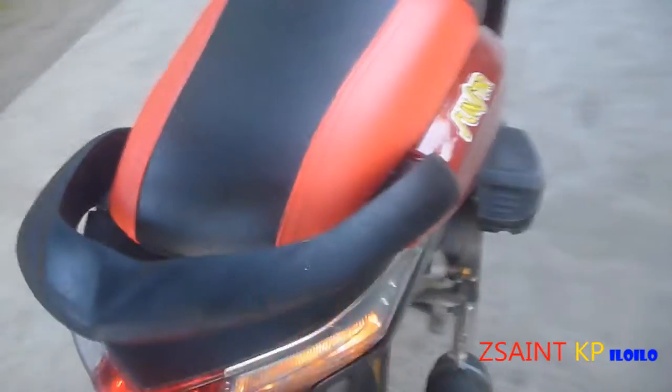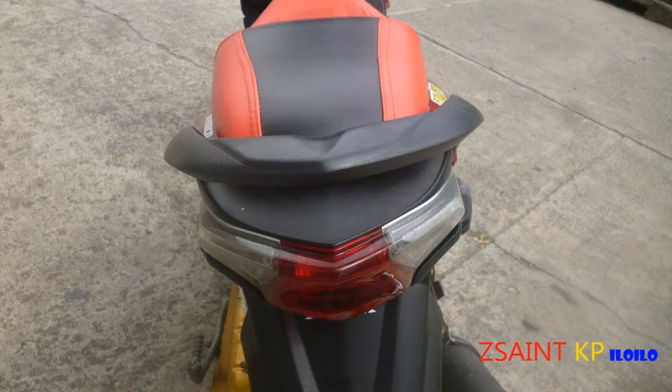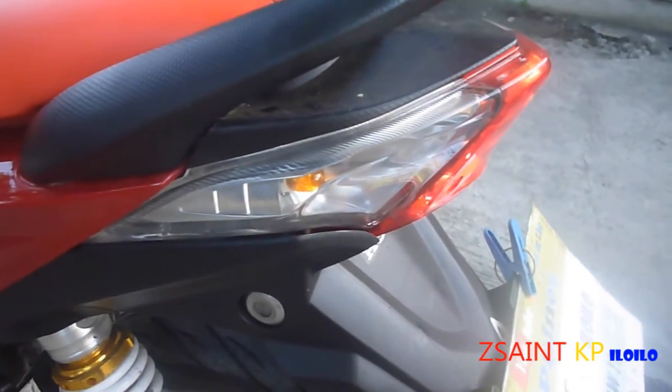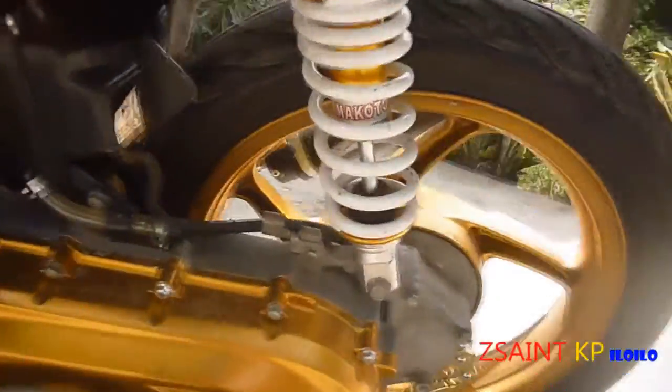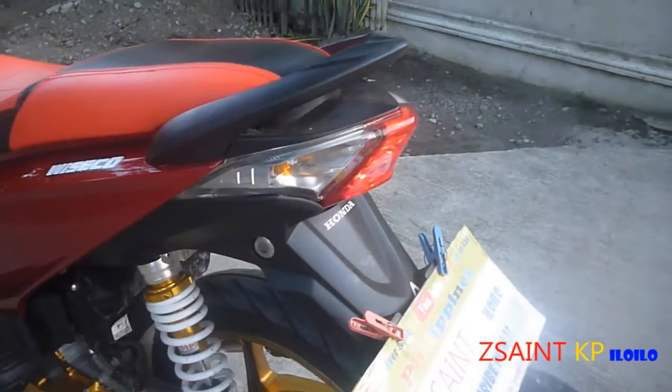All the features of the scooter include halogen projector headlights, urethane handle for the rear, aftermarket exhaust pipes, key shutter, projector taillights, automatic choke system, side stand switch, 1PC engine cover, and dual seat design. Going to the rear wheel, the rim is the same as the front wheel, but it is wrapped with 80/90-14 MC 40P. Brakes for the rear consist of mechanical leading trailing. The rear suspension is a mono shock unit swing.